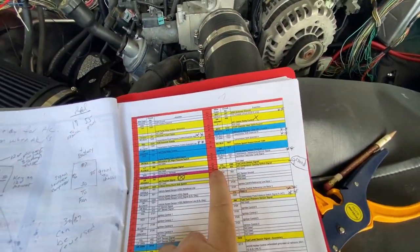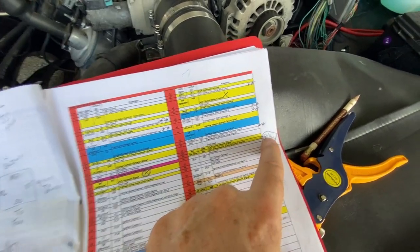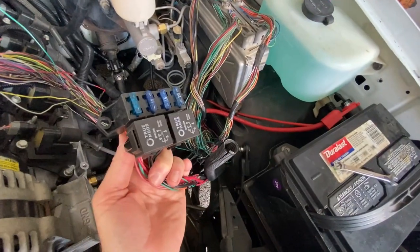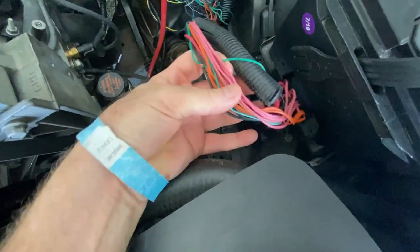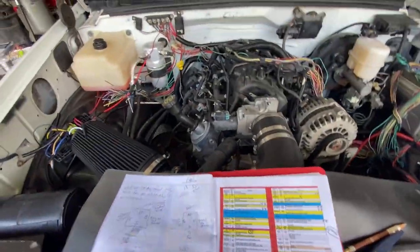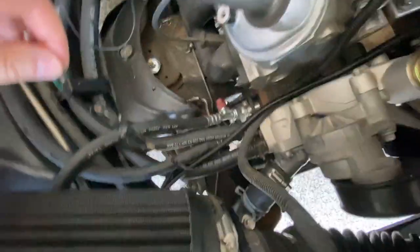Below your accumulator there are two green lines. One goes up to the switch itself, and the light green goes back into the firewall. There is a second dark green wire that goes up the other direction — that would have gone to the switch inside the truck. So number 17 is going to go to that green wire, the switch side, because that 17 has to get the activation for that to work. The other wire that worked is number 55, a dark green wire labeled as an AC compressor cycling switch signal. What we used it for is a ground — we literally grounded it to the main relay on the ground side of the fuse box relay. So that provides the ground and provides the power. The compressor has to get the signal, so I spliced that black wire from the compressor into the dark green line coming off my AC accumulator, which goes ultimately to the compressor itself. That will make the air conditioning run.